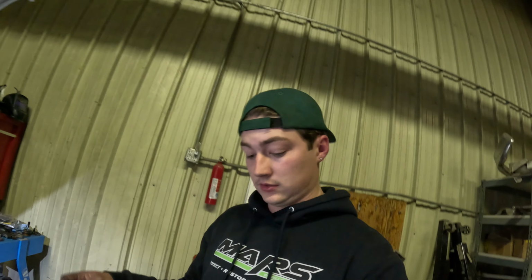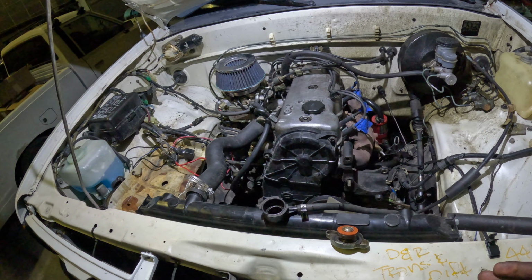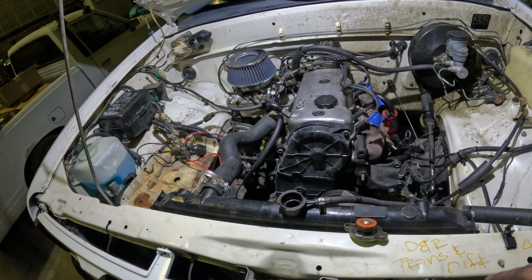Shut it off, drain it, and then cycle it with water until it comes out nice and clean. And then after that, I'll fill it with coolant, and then hopefully that's gonna be good. I think that's how we do it. After that, yeah, before that, I mean, we got to do the oil, because it was ready for an oil change anyway, and I don't know what's in this oil now after that whole, you know, situation.